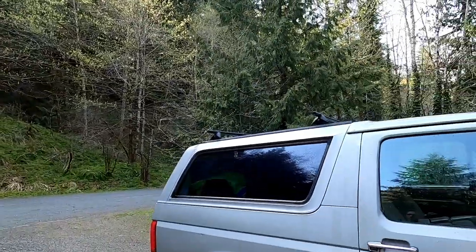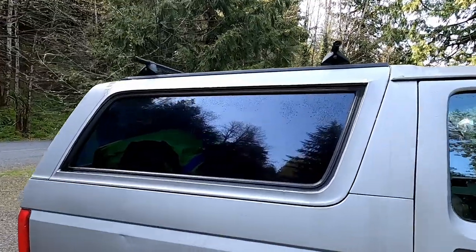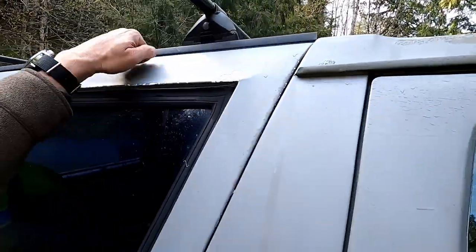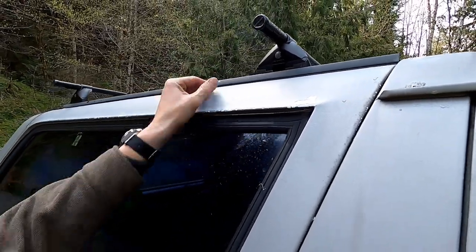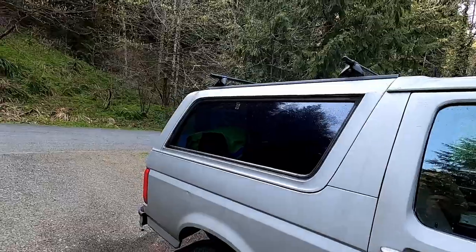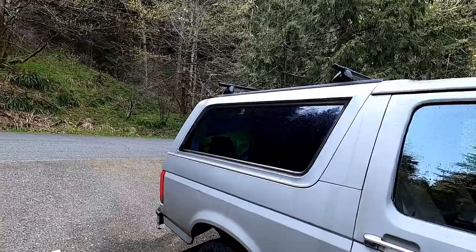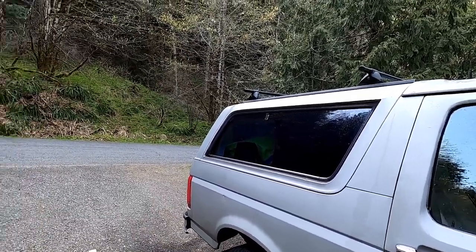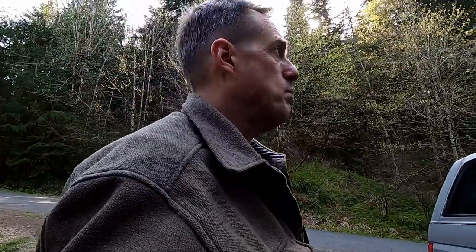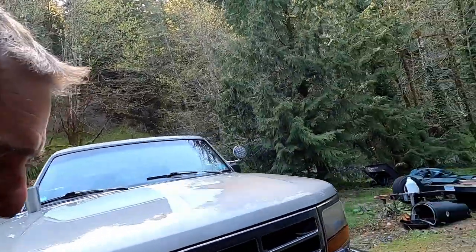Could you install these roof bars better? Yes, absolutely. I would say that you want to stick to drilling into this solid section, not that thin part. I like the track idea because it distributes the load. The tracks are installed with quarter 20 bolts — I bought one-inch ones to go through the fiberglass. The Yakima bars have their own proprietary Allen wrench hardware, but I think she looks pretty good, all things being equal.